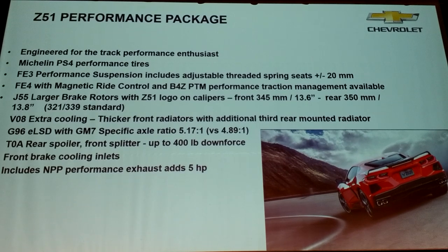So the oil doesn't go down — it runs up. When you're cornering hard, the engine oil actually wants to go up into the valve covers. That's why you have sumps on either side to take that oil out, plumb it, cool it, de-aerate it, and feed it back to the engine so the engine always has nice, cool oil with no air in it. We made that standard.